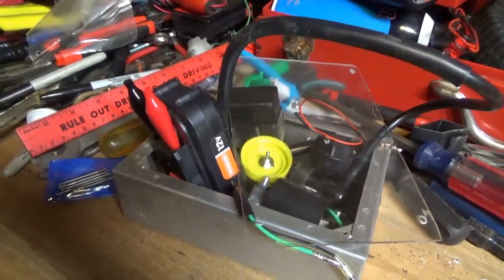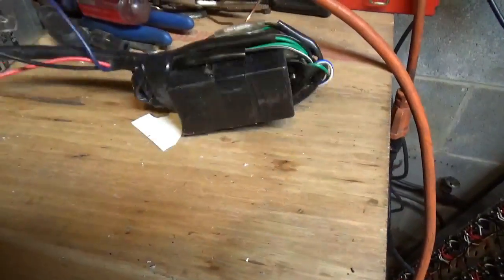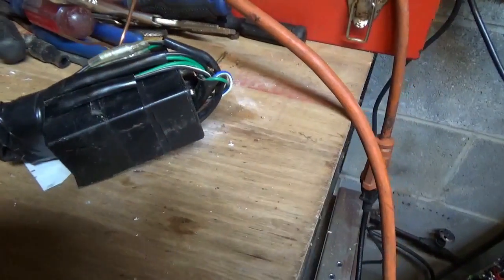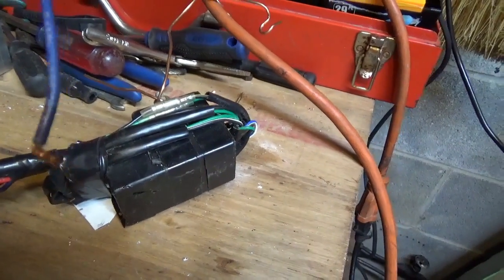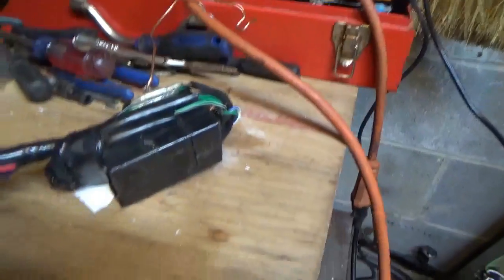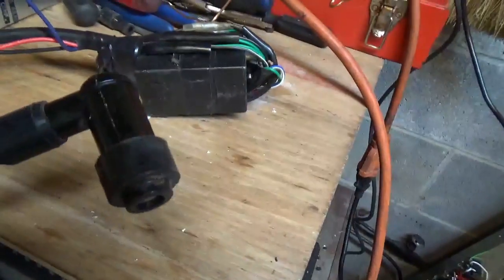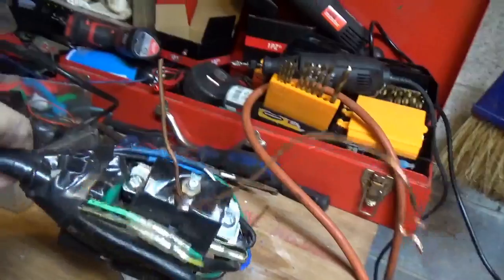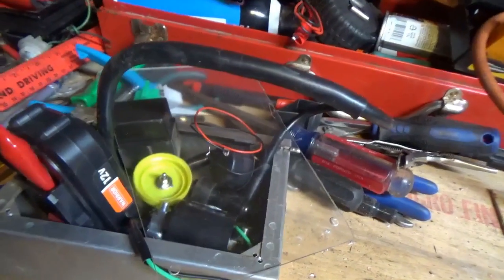Once you have all your stuff, you could go caveman style: just plug everything into the harness, hook it up, smash that onto your spark plug, 12 volts between here and ground. Take your blue wire, extend it a bit, hook that to the blue wire on the pulse generator and the other side to ground. Hook ground to ground, make sure your engine is well grounded, smash on the spark plug wire, and once you put 12 volts on this, she's ready to take off. Or we could build something that actually looks nice and you might be proud of.